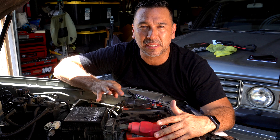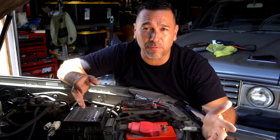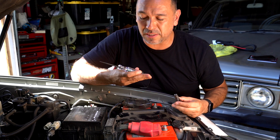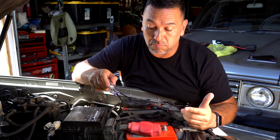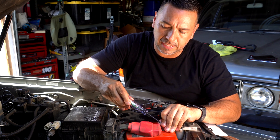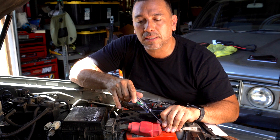With Odyssey, you want to be at 12.85 or 12.8 depending on your meter — that's a fully charged battery, and that gives you the health of the battery by the voltage. I have my battery tester here; you can pick one of these quick, easy digital voltage meters on my Amazon store in the description below. I just came in and parked after the trail — it was super hot — and it's reading 12.3.